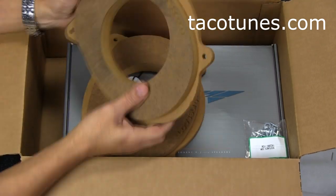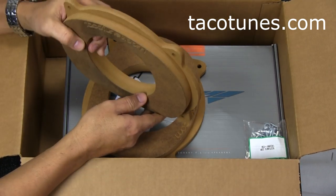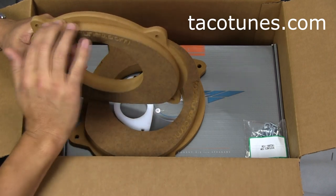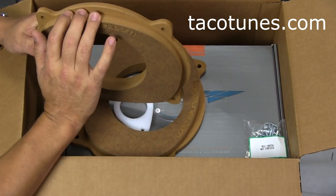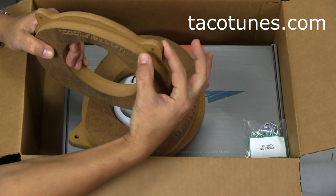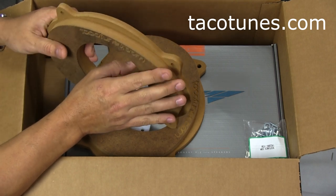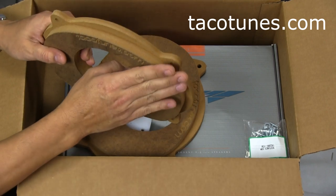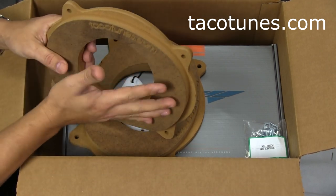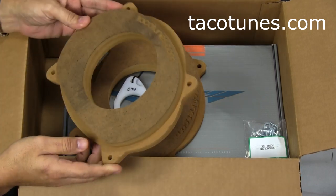This is a full one-inch thick. You're going to notice that the speakers are trimmed out here, very similar to what's in your Toyota already. The reason for that is, I've seen guys that have tried to make speaker mounts and they don't remove this excess material to make it like the stock setup. What happens is it's a full three-quarter or one-inch thick, and they're putting pressure against the door panel, which causes stress creases and makes your door rattle because it's pushing on the door panel in a way it was not designed for. When you install this set, it doesn't put any pressure on your door panel, so it's more like the stock setup. That's why we cut these precisely to fit and make it look just like it was when it was stock.